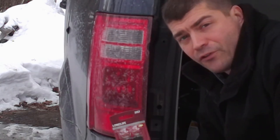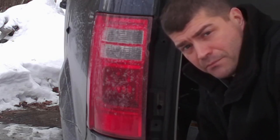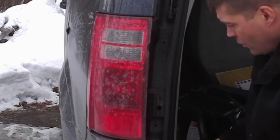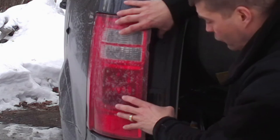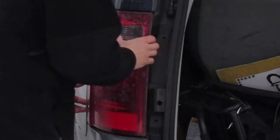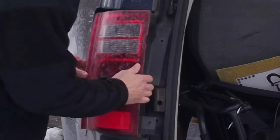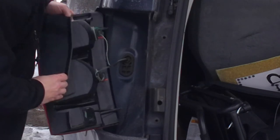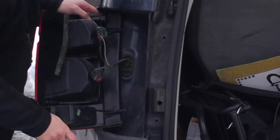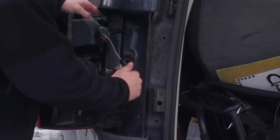Make sure you get the proper bulb for your vehicle. This is a 2009 Dodge Grand Caravan. The bulb is a 3157, so we're going to go ahead and put that one in. Now that we have the two screws loose, we should be able to just pull this right off — just like that. The directional that we're fixing is in this one here, so we're just going to turn it down and pop it right off.